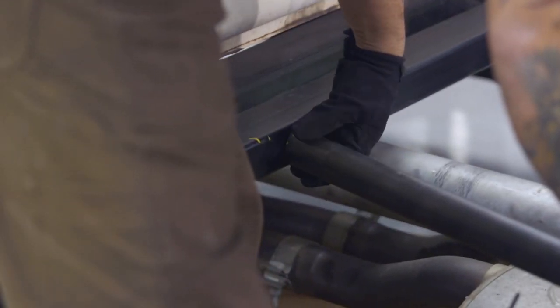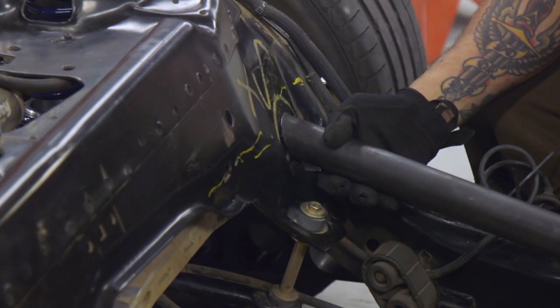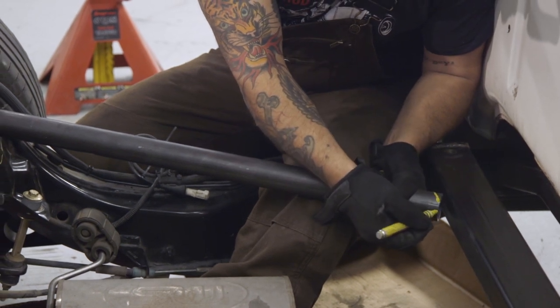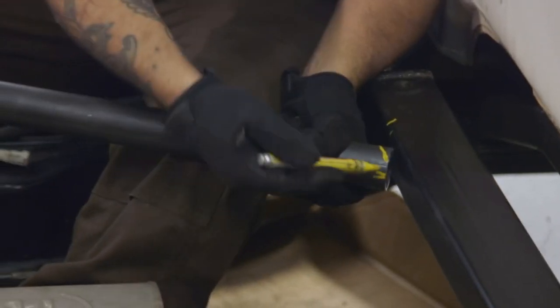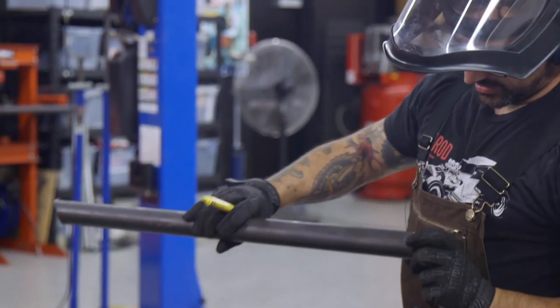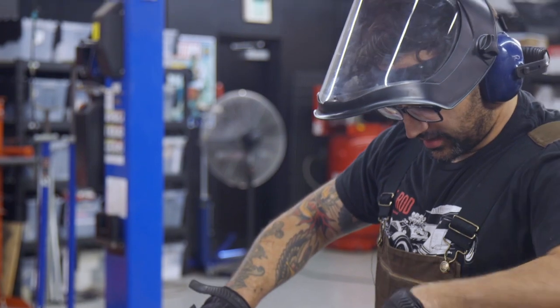When you're fitting two different angles together, it's a little bit tricky. I've got the angle just right the way it's going to go in the back of the frame. Then I'm going to mark the ballpark line and then mark the rotation of the pipe by doing a horizon line. These marks let me know how it's going to sit, and then I'm going to cut it across.